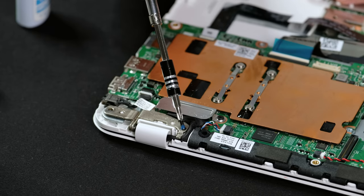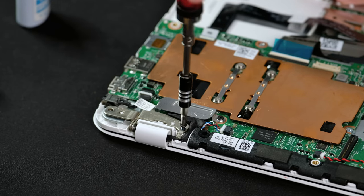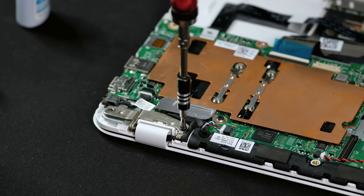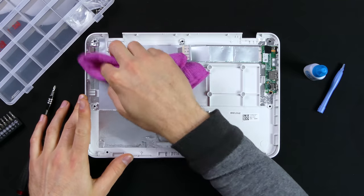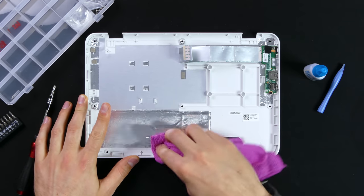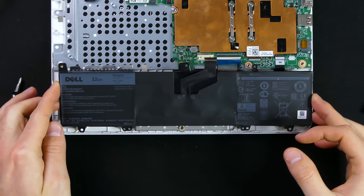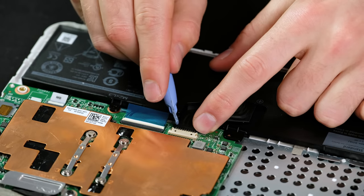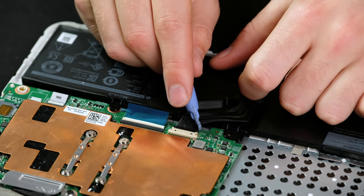To make sure that the screen hinges don't become loose, I went ahead and applied some threadlocker — this will keep the screws securely in place. While the laptop was pretty clean inside, I made sure to wipe out any debris that had accumulated on the bottom casing. And now we could start putting it all back together. There was no real point in taking it apart any further, as there was nothing more I could clean inside.